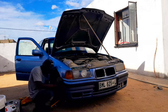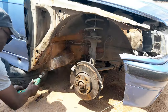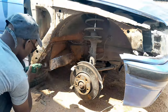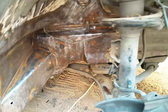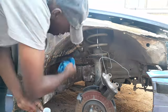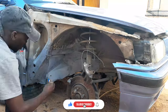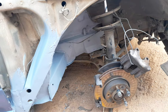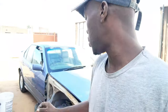The fender is finally out. I'm going to use a drill and a wire brush to remove the rust down to bare metal. The aim is to make sure all the rust is removed. Removing rust with the drill looks easy but it is time-consuming and tiring. After revisiting spots I missed, it's time to use some alcohol to clean the surface because we're going to paint it with primer. The main aim is to cover all surfaces so the rust will never come back.